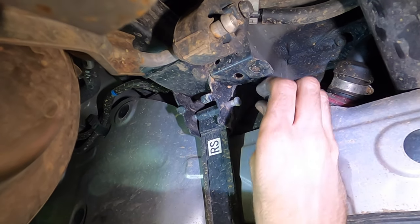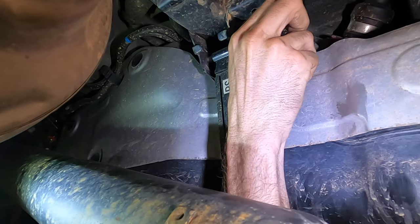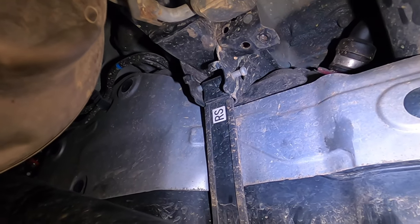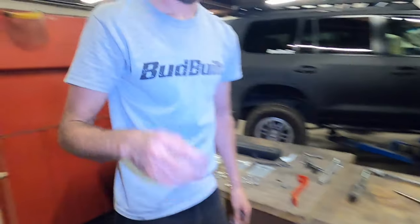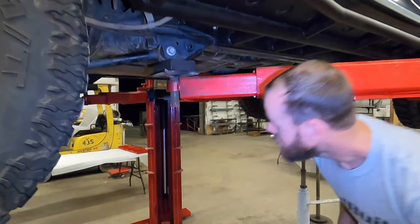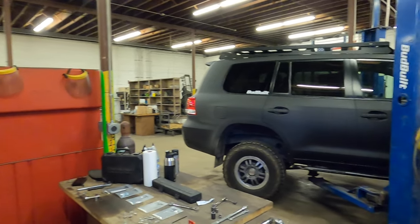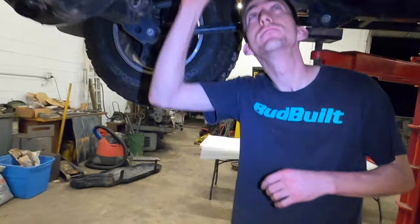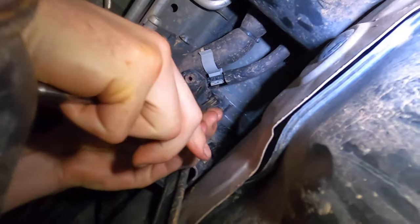Now this can happen sometimes, so I'm glad this happened here. When this fuel skid came out, it was a little boogered up. A little bit of corrosion in there, so we're gonna run a tap through that. If it's an M8, it's gonna be a 1.25 by M8 thread pitch. And now we wait on Chip. The T handle doesn't fit.